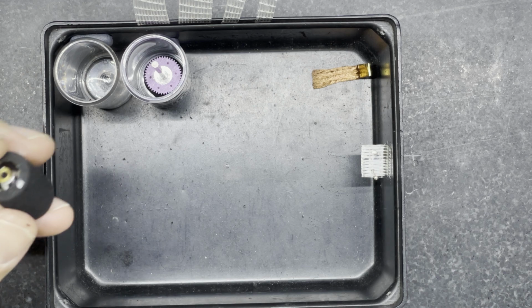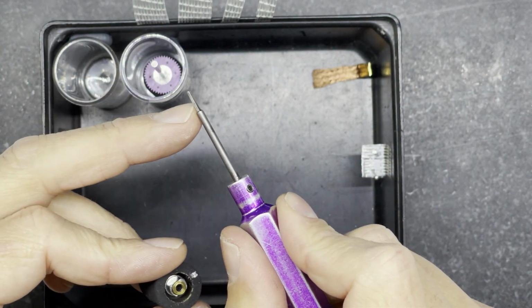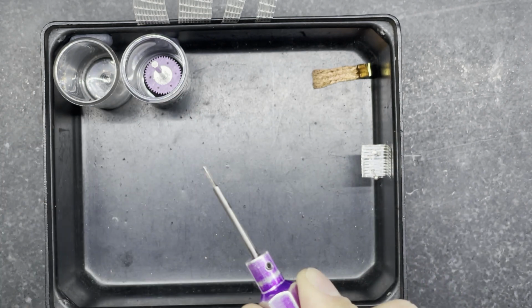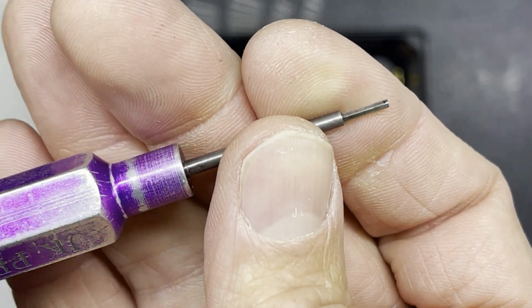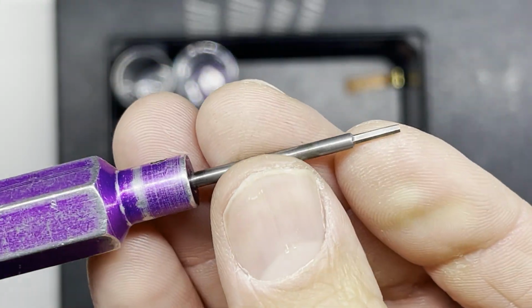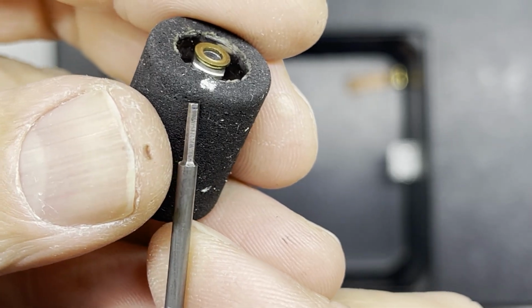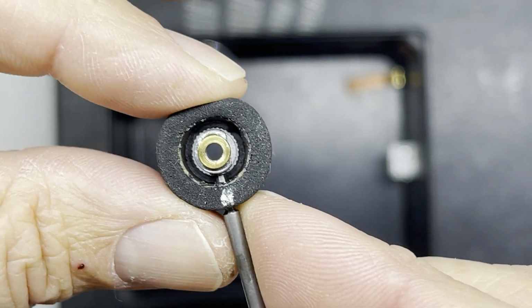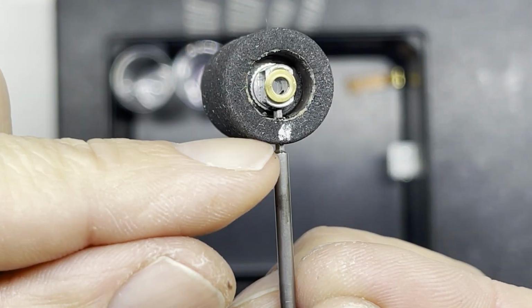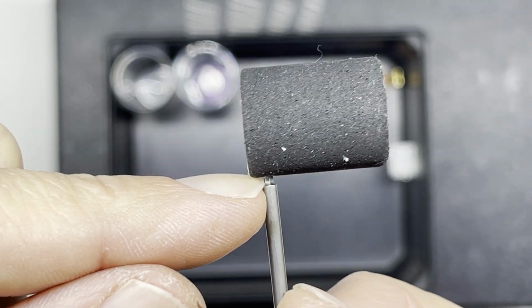And what I might do as well is I've got these Allen wrenches. These Allen wrenches have very long tips to them. I'll bring it close to the camera. There we go. So you can see it really close to the camera. They've got really long tips on them, which is really good for going through your tyre into the grub screw without having to put the really thick part of your Allen wrench through the tyre and make a big hole in your tyre.